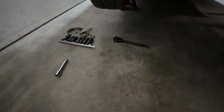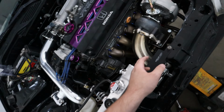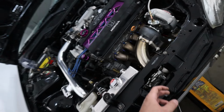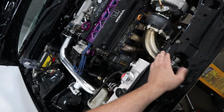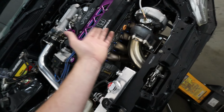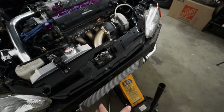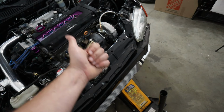All right, guys, wastegate dump tube is off. Everything is good to go. Downpipe is disconnected from the bottom. Now it's just time to work these 5 Allen key bolts. Take off this little Circuit Hero cooling plate I have, and then fingers crossed, and hopefully we can just finagle it out of there. But wastegate dump tube's off, all V-bands are off. Let's take the top stuff off, we should be mint.